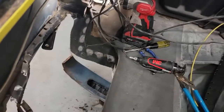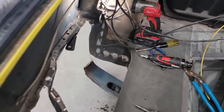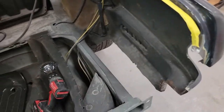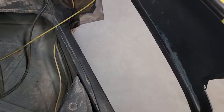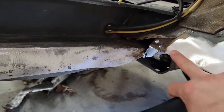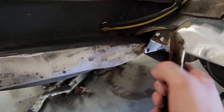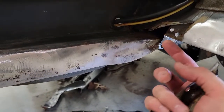I'm going to go through and cut these welds off and just try to get this flange out of here — that whole piece will be out. Same thing on this side — got the same kind of repair there. Just got this one out. It's layered in between this little gusset piece here between the frame rail and the wheel well — actually between that and the inner wheel well. It's up in between these two pieces and has to be lifted up to get it out. I drilled it from the back side so I can weld when I get it back in there.